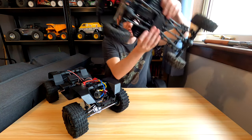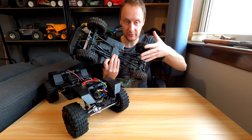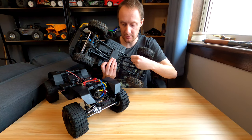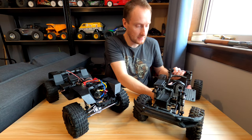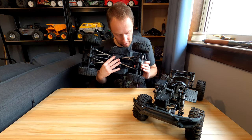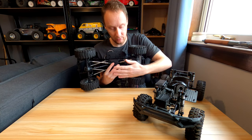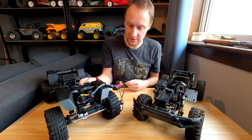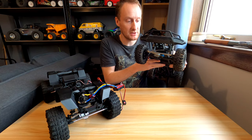You can see this one has plastic links all over, which are fine. They slide off rocks easier than scuffed-up metal links, so that was the thinking behind it. But they get weaker with age — the little vibrations that go through them all the time — and they start to flex more and more, whereas metal is much more consistent. This one comes with aluminium links all round, but I fitted stainless on the lower links and kept the lightweight aluminiums on the upper links, just trying to keep the weight down low as much as possible.